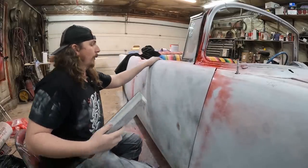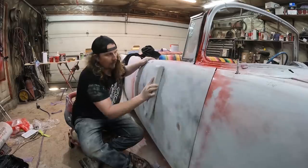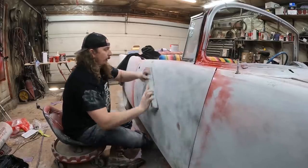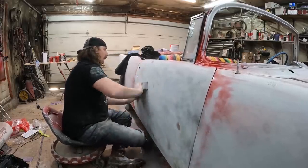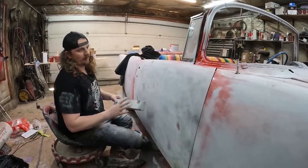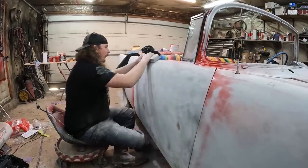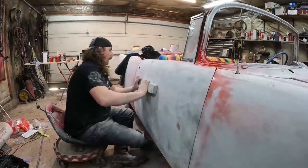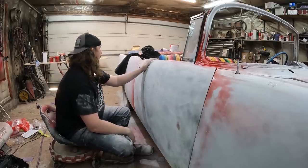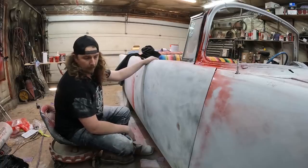As you can see, it's all going to come off pretty quick, pretty easy. We'll know that wherever there's no guide coat, it's for sure in 320. Then I might hit it again just with some 400 — just to be the real nitty gritty. It still needs a little bit more there, but pretty much ready for paint. Honestly pretty straight, straight enough. That's what we're going for — good enough. I don't have much more time lapse I want to do on blocking out. It is boring, I'm not going to lie. I'm doing bits at a time, just taking breaks because my brain can't take this.